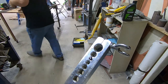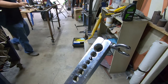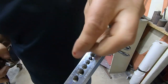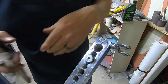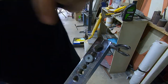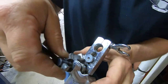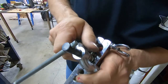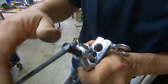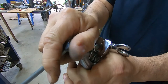Yeah, I'm even gonna grab a pair of vice grips. I'm going to stick this tool in, you know, it says 3/16 on it. It says 3/16 here. So just a little basic reading there. Make sure you got the right stuff. Then I'm going to come in here. I'm going to twist this. And I'm going to have to back that out because I just finished making another flare. And then try to get it as centered as possible and get that little button sitting square with the top of that line. It's pretty much the key to getting a good flare every time.